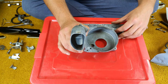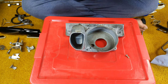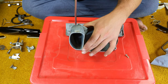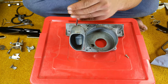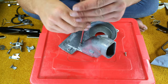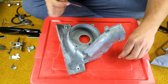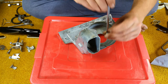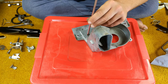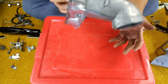Just get the blobby bit out of the end of the nozzle. You're not using much — just enough to form a little gasket. We use clear just because it looks nicer than white, so it can ooze out a little bit and you won't notice it. With a little smear just around there, stick this on like so. Let me go to our screw card and find our air duct screws — these go in top and bottom. Get it nicely lined up. Another one sits back here like so — tighten down until they're nicely into place.